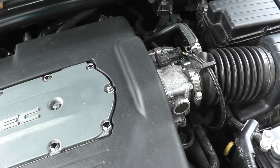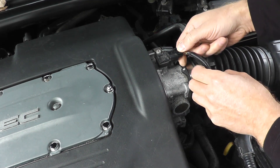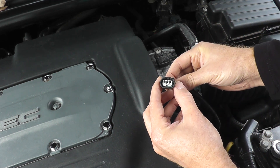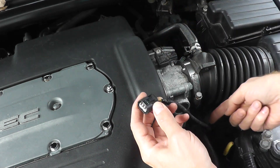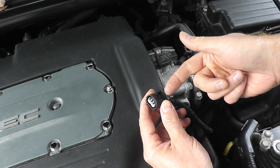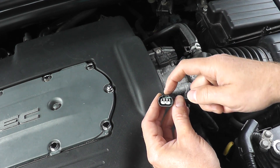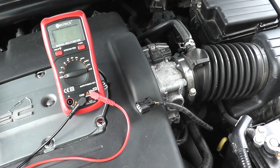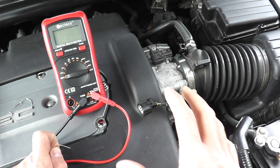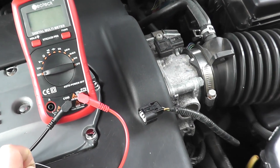In my case I don't have a problem — as you saw with that scan tool reading, I'm just doing this as a how-to. What we're going to do is disconnect the harness connector. We want to obtain a voltage reading — in other words, verify that power is getting to the sensor. We'll turn on the ignition key without starting the vehicle, and we should see five volts of power. To do that, we need a multimeter. This is a digital multimeter, about $20 from Amazon. An absolute must-have if you plan on doing your own auto repair.